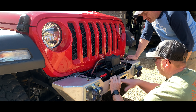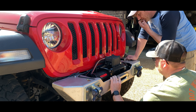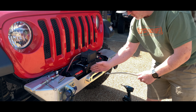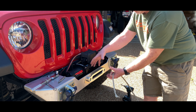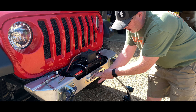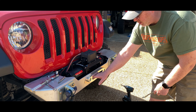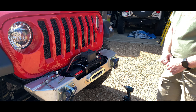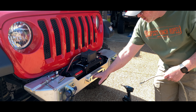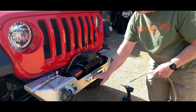You can feel how that edge is right there. So what did you do? Grind it down. During a hard pull on the rope, it will never spool up correctly — it will always bundle up on one side of the drum. As it does that, it will make a larger diameter turn, which will bring the rope through the fairlead, and as it goes down, it will rub against the back edge of the fairlead opening. If there's a sharp edge on the bumper, it will scrape the rope for approximately eight to ten feet before it cuts the rope. We always recommend rounding off this back edge so there's a nice smooth transition from the fairlead back — no chance of the rope rubbing against it and damaging itself.